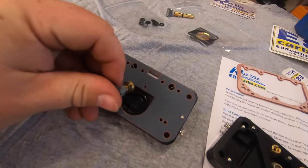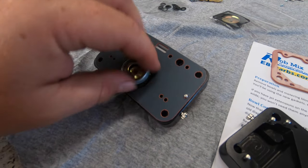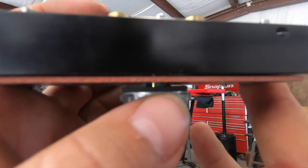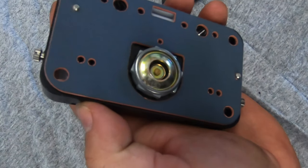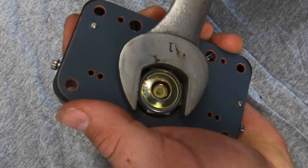After making sure all the parts are in the box we can assemble the metering blocks before we remove the carb from the car. We'll start with the power valve. Take care to make sure the power valve gasket is seated properly. I like this hanging method for installing it. Take a look around to make sure the gasket isn't sticking out unevenly, then tighten it until snug with a one inch wrench.